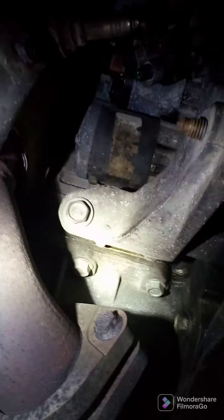You're gonna have to remove a motor mount — 15 millimeter. You got a bolt up here you're gonna have to remove right there, another bolt right below that, and that's three bolts there. You may also have one hidden bolt up top, and you may have to pull this dust cover off as well.